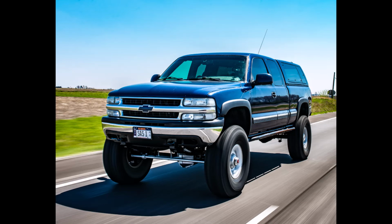And speaking of that, I hadn't broken an inner shaft until we went to S'more in November. So the Dana 60 is pretty stout, even with 40s. But now it's got chromos. Yeah, now it has chromos. Those were stock shafts, stock neck down shafts too. Do you really attribute that break to the bosses?